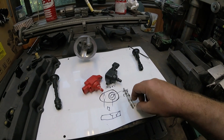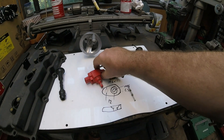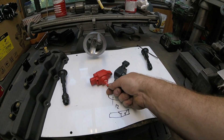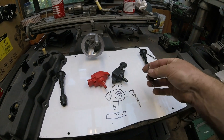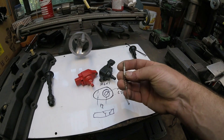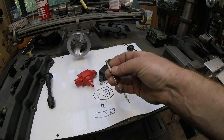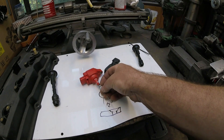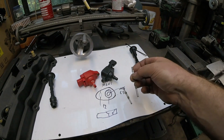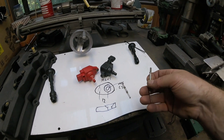The VR38 coils, at least the ones supplied from Savage Performance and Spears, have a carbon in the end of the coil itself. The stock VQ35DE coils have a carbon in the stalk. You can't run both together — bad things happen. The spark tries to jump out the side because there's too much resistance there, then you'll chew a hole through the side of your stalk and you'll have a misfire.